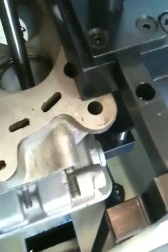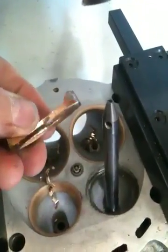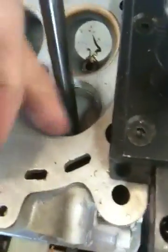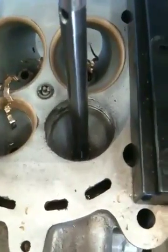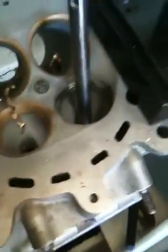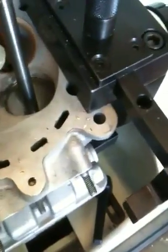There's one of the seats removed. This isn't our final seat pocket — we're going to re-bore this hole and make sure it's square, and when we put new seats in it, we'll get to that in the next video. So that's the removal of the seats. I'll move over and remove the next one — you don't need to watch the video for that one.